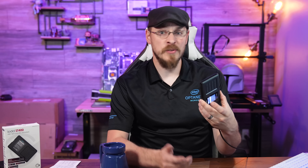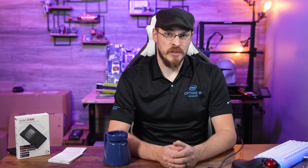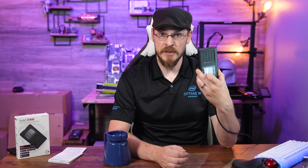On top of ISOs, virtual hard drives — VHD files — can be mounted and emulated as either USB-attached storage or as a physical hard drive, allowing you to install Windows or other OSes that don't allow installation onto a USB disk. However, the use of VHDs requires an NTFS format. NTFS is not natively supported by macOS or Linux without third-party tools, which can make management difficult. IODD offers a Windows-only tool for creating VHDs and managing other features on the drive.